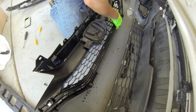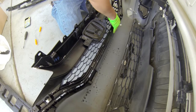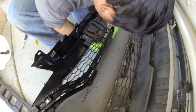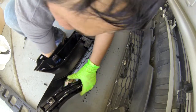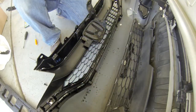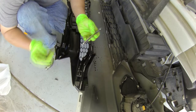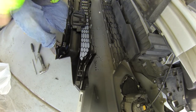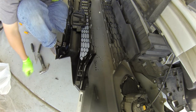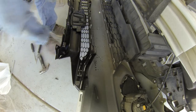Pretty simple. When you put it back, just lay it into the clip and push to lock it in - that's all you have to do. The hardest part is taking it out, but putting it back is easy. Make sure you lock it into the clip. In case your clip does not slide in to lock, use a quarter extension right here and tap it until it's locking. Slowly tap - don't break it. You don't have to hammer all the way, just slowly tap and it should lock.